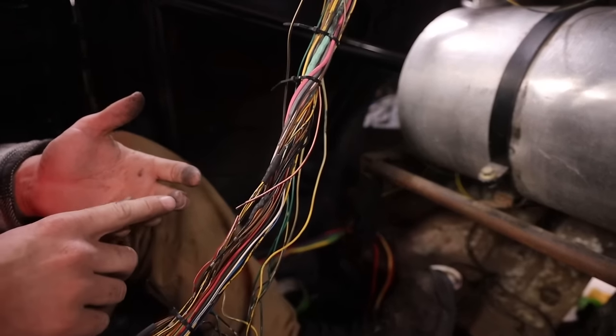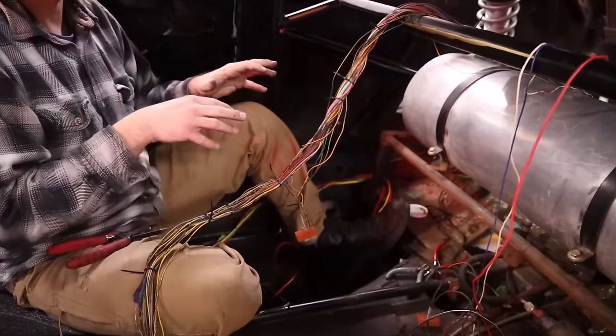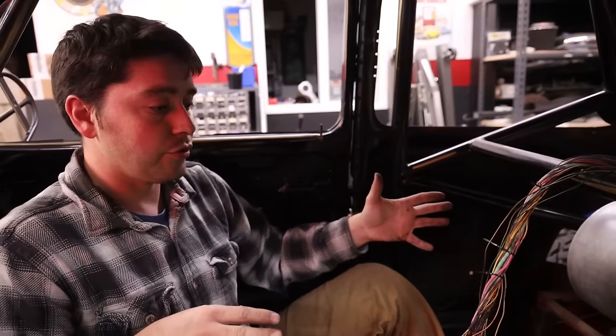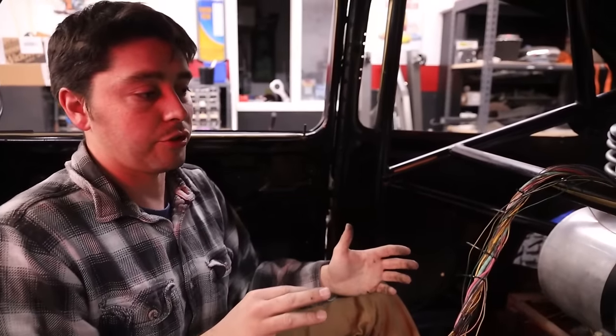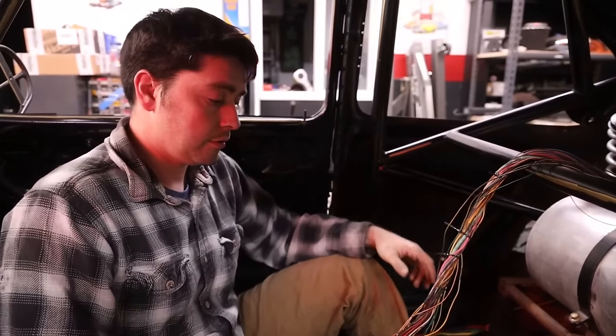And it's going to last longer in the long run because you're not using butt connectors. Yeah, no, that'll be good. And then obviously staggering them keeps everything nice and down. And what I'm trying to do in the long run is to bulletproof your wiring. So when you are going over those dunes and ripping it, you don't have to worry about this. Yeah, if the harness wiggles around, it's not going to have a connector.